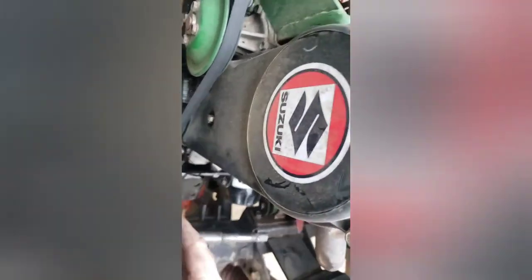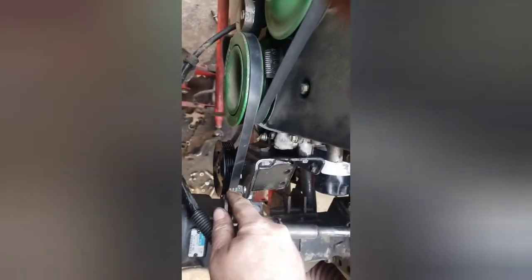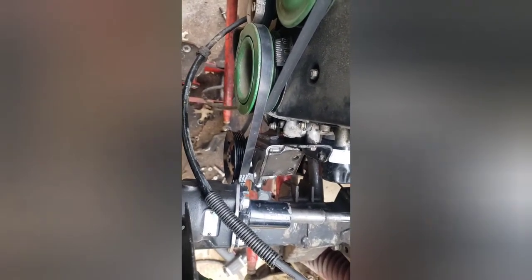Idler here, it's going to be AC here. Belt will do a full wrap over the crank, come back, catch the power steering, go up, catch the AC — the AC compressor which is my air compressor will handle the tension. I believe we should be in good shape. Now if I find out that this belt coming back up hits here somewhere, then I'm going to end up probably having to pick up another idler to catch it and bring it around. The problem with idlers is that every time you add another bend, it's just another opportunity to bend the belt, and if you're going to bend the belt, eventually heat's going to build up. I'd like to not have a bunch of heat build up, especially on a belt that is controlling your steering.